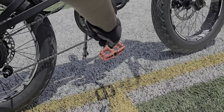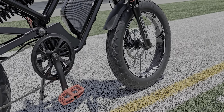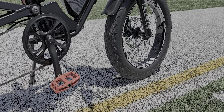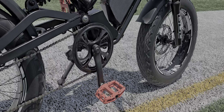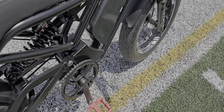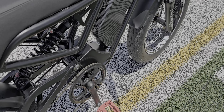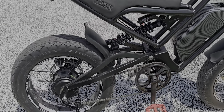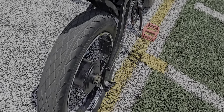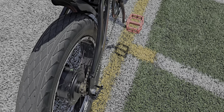Normally on a moped style frame, the seat and this nut are parallel with the crank arm, but because of this off-road-ish design they raise that up a little bit, which makes it harder to pedal normally. So having a 38 tooth with 152mm arms lets me pedal at 25 to 30 miles an hour, keeping up with the bike's speed. I went with a single gear conversion in the back — a 12 tooth.